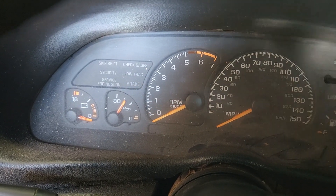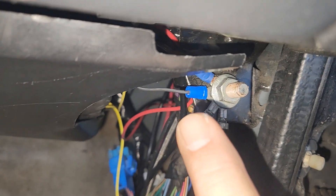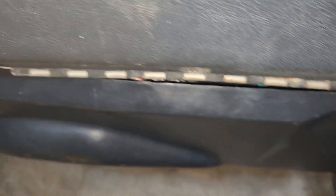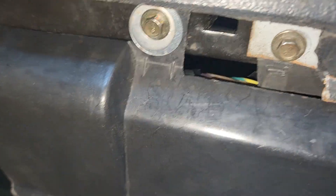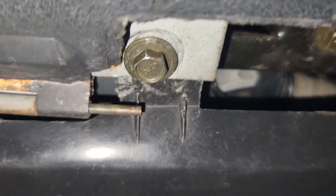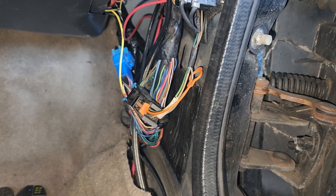Works for me — tach is good. Now we've got to do the power and ground. I ran the ground wire right there to the ground stud. I ran the red wire through there — put some washers on the bracket so it'll hold better. Now we'll put the kick panel back on and go to the other side to hit the power hub.